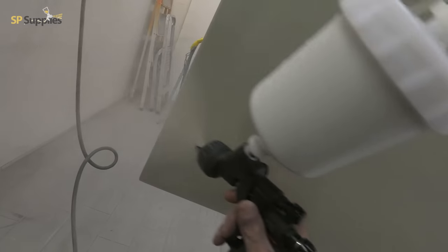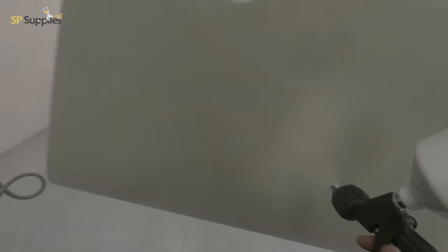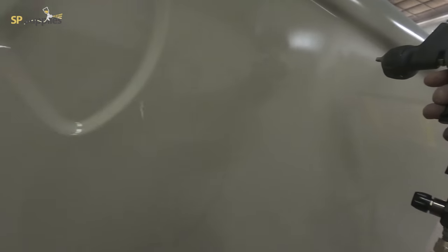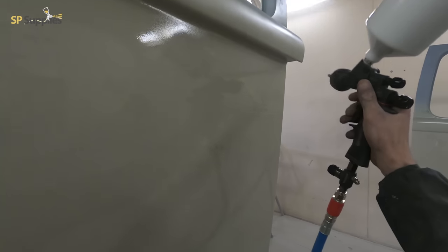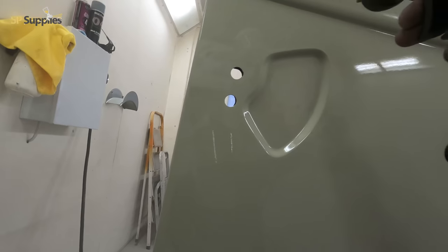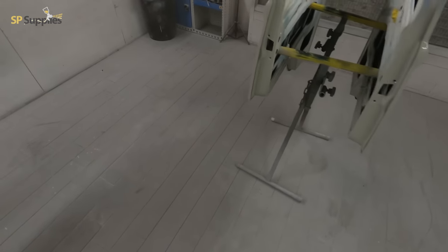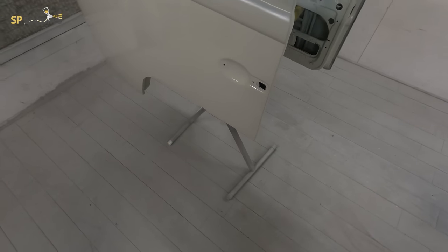Mix wise for this direct gloss, I've gone for a medium hardener and put around 10% slow reducer in it, which I find helps with the laydown. The medium hardener just helps with retaining that gloss and a really nice gun finish when it's been baked off. I'll leave a link in the description to the spray gun and my air fed setup from our sponsors over at SP Supplies. I hope you've enjoyed today's video — I know it's a little bit shorter than usual, but I really wanted to get up some footage of the paintwork on this camper and give you guys a glimpse at some of the new kit we'll be using on the channel. Thanks for watching, and I'll see you again soon. Bye for now.